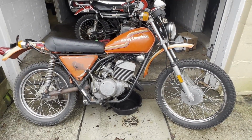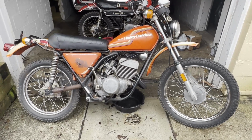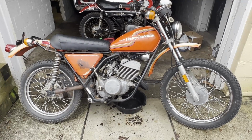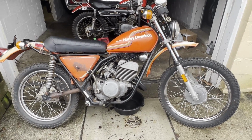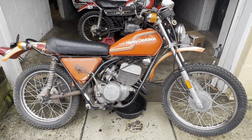So I let this thing run for another good 25 minutes trying to get it to clean out. It's still spewing oil all over. So I think I'm going to drain the oil again and put it right into the measuring cup that I used to put the oil in so I can see if it's using up oil. That'll tell me for sure if it's the crank seal on it. So I'm going to give that a try. I'm draining oil now.